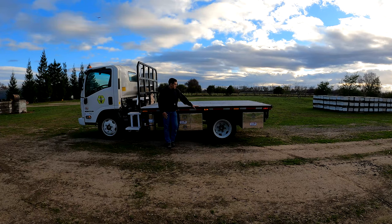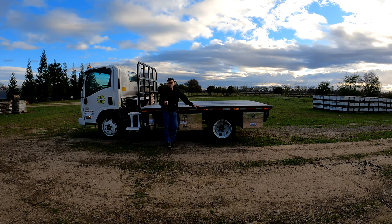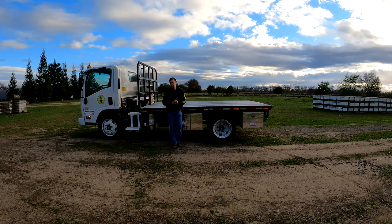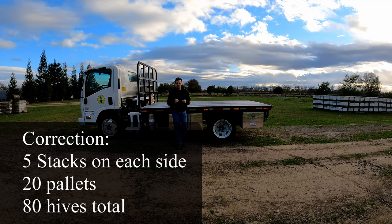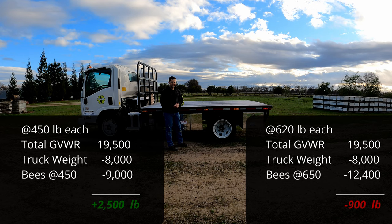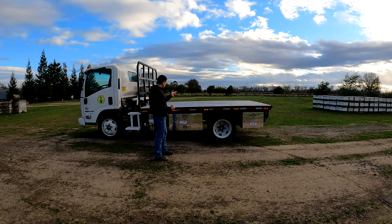Let's discuss the length of the flatbed — this is a 12-foot flatbed, and most people make them much longer. Bees are extremely heavy. When we decided to buy new trucks, I did the research — I'll make a separate video on weight distribution, but that's a big factor in why it's so short. For a 19,500 lb GVW truck, I believe this is the shortest flatbed with six stacks on one side and six on the other, which is the maximum weight. Our hive pallets of double eight-framers average 450 pounds, ranging from 320 to 620 pounds — bees are extremely heavy. We felt this is the optimal flatbed length, and if we need more capacity we can attach the gooseneck.